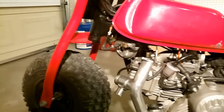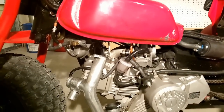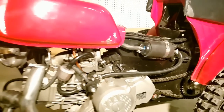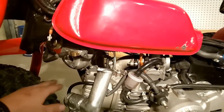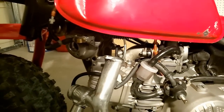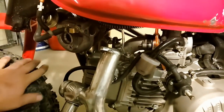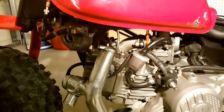For rideability — a couple people have asked — as long as you're in the mid to upper RPMs, this thing screams. It's fun. It's stretched two and a half inches and will wheelie every gear you shift into. That's on 10 to 15 pounds of boost. I've had it to 20, but this compressor is way out of its range at 20 — I don't think it likes more than 10. We are going with a new Garrett GT1238, which will open up the exhaust a lot more and the compressor is a little bigger, so we'll have better bottom-end power as well.